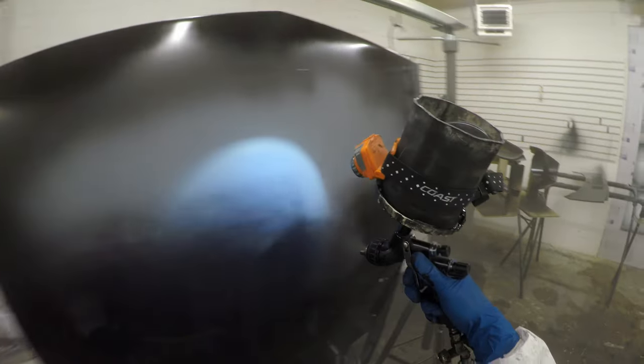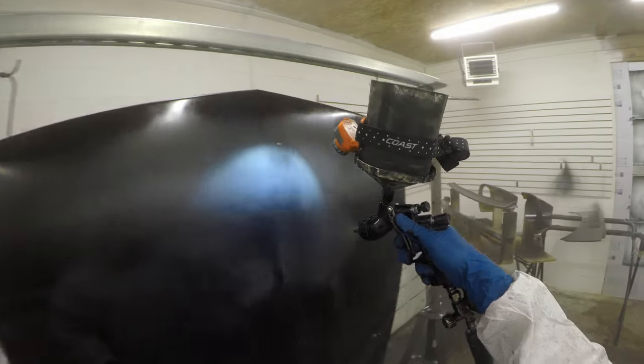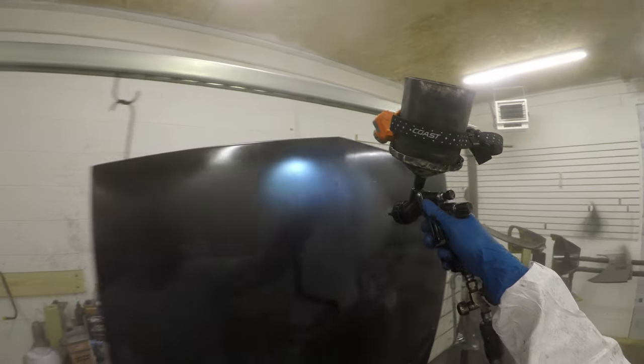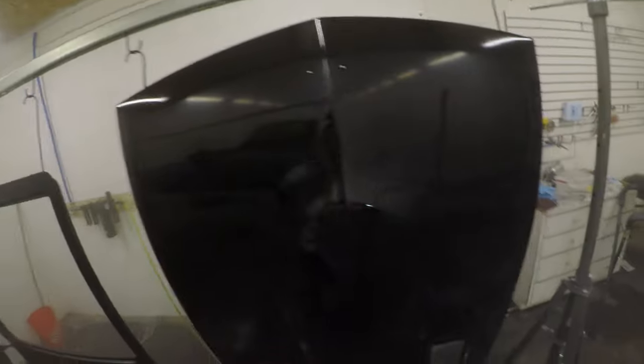It's a black pearl. I want a black car with the metallic paint, and it was applied over a black substrate. So that substrate right now is gray 2K primer, and that's the reason for the sealer. So with a gray substrate that we have wet sanded the day prior, we would get a difference in color if we put base directly over that.